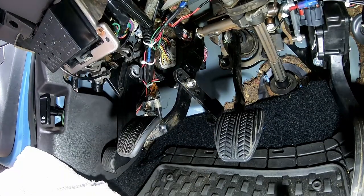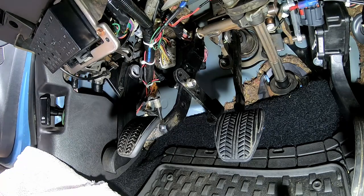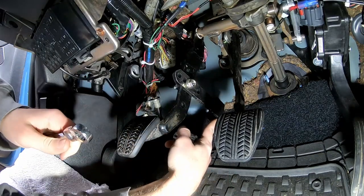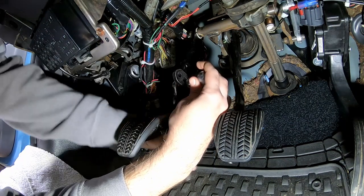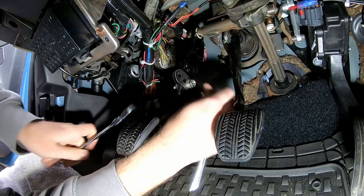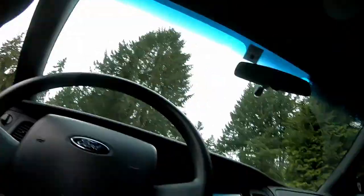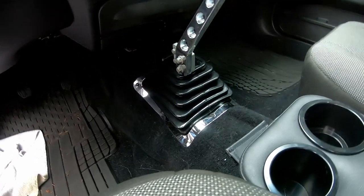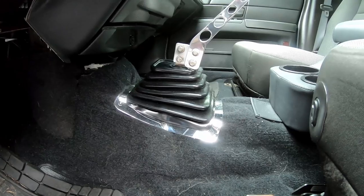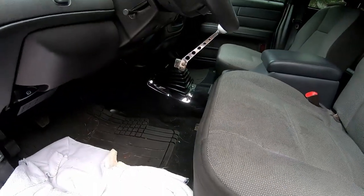Let's try it because we don't want it to grind gears. We'll get our tools picked up, snug that up just a little bit, and then we'll start the car up and make sure it'll go into gear without grinding. It doesn't have to be god-awful tight, but enough so that it doesn't move. You'll have to pardon our gorpy shifter boot — that shifter boot is somewhat temporary. That's a copy of a B&M automatic shifter boot. We just temporarily stuck that on there to quiet the car down — it's actually incredibly loud inside without a shifter boot on it.